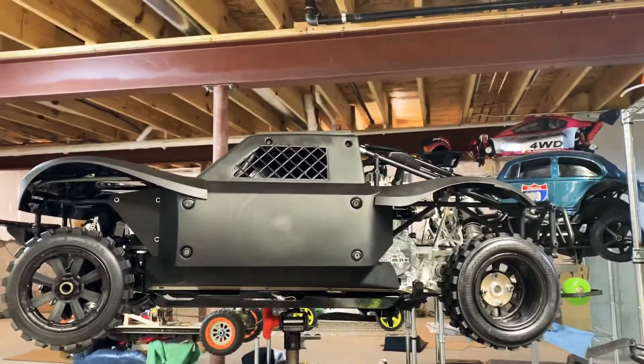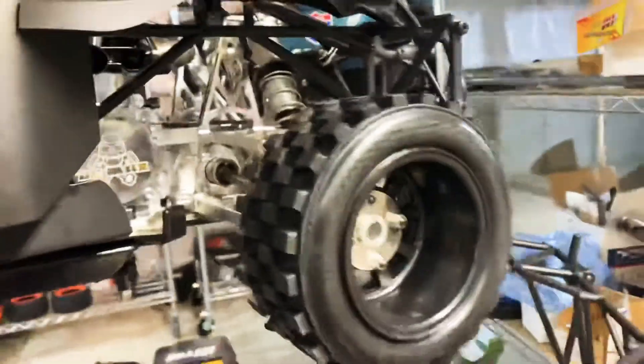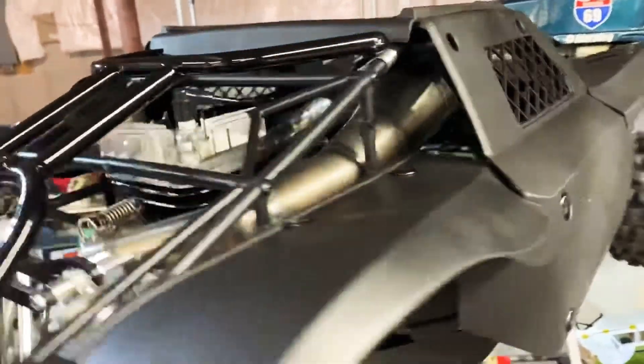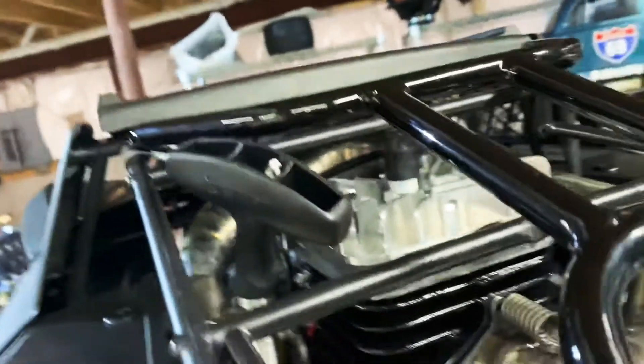What's up YouTube, MCJohn here. We got another update. I don't even know where to start — it's done. Fitted the cage, BDR crash bar, had to trim the exhaust brackets a little bit to get the cage to work, trimmed a little bit of the cage, not much, still have full protection, didn't have to notch anything out. Fonzi pull start extension brings it up here nice and easy so you can start it with the cage on — no pulling the cage off except for fuel.